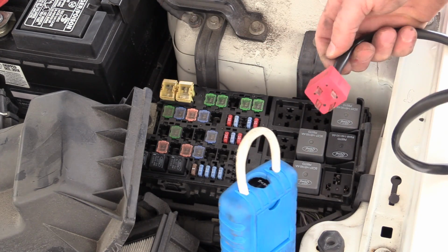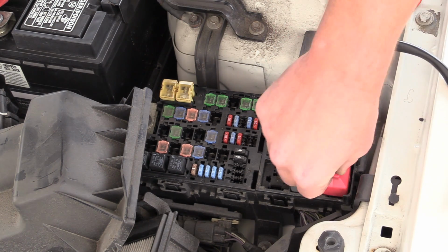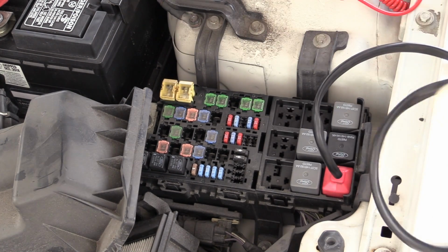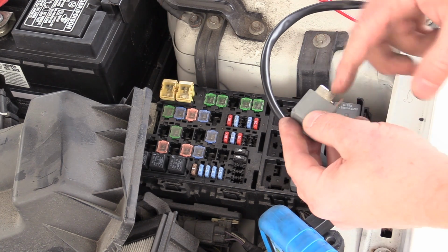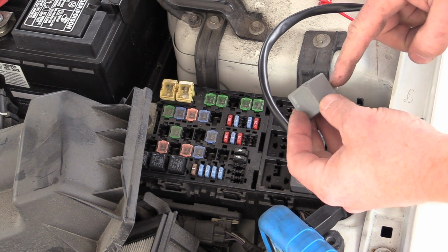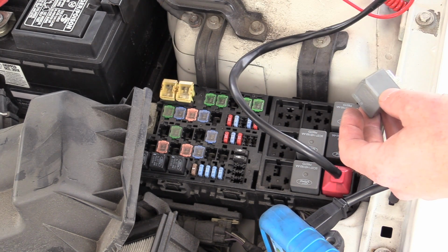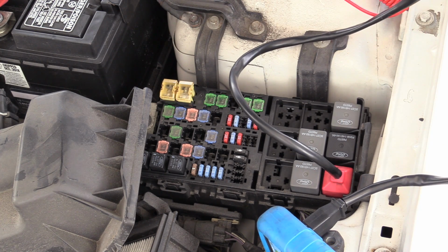We're really not done with the relay yet either, because we never checked the computer control of the relay. All we've done is test the relay. In my test, I was actually being the computer. I was doing what the computer would do and grounding that pin. So I'm not checking the computer control of the relay or the driver. And that's where our bidirectional test would come in.